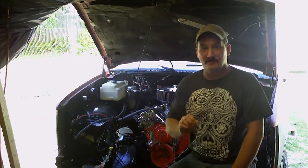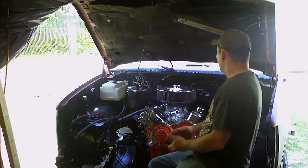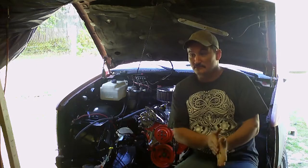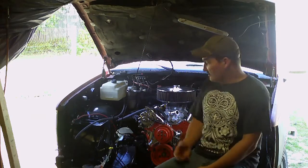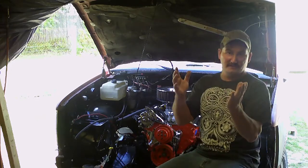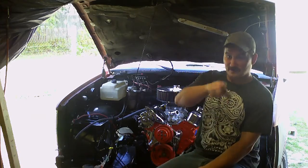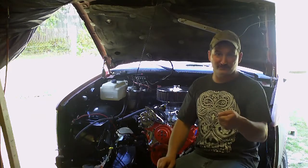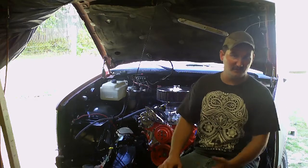This saves you a lot of time, a lot of work, a lot of pretty much everything. What I've seen online — most people do when they go to change these things — is either they cut holes in their frame to get to the bolts on the engine mount. The engine mounts on these things bolt to the frame itself. You've got three bolts inside the frame housing that you can't get to. So a lot of people cut slots into the frame to fit a wrench in there to unbolt the bolts, and then they've got to try to hold the bolts to get the new mount started.